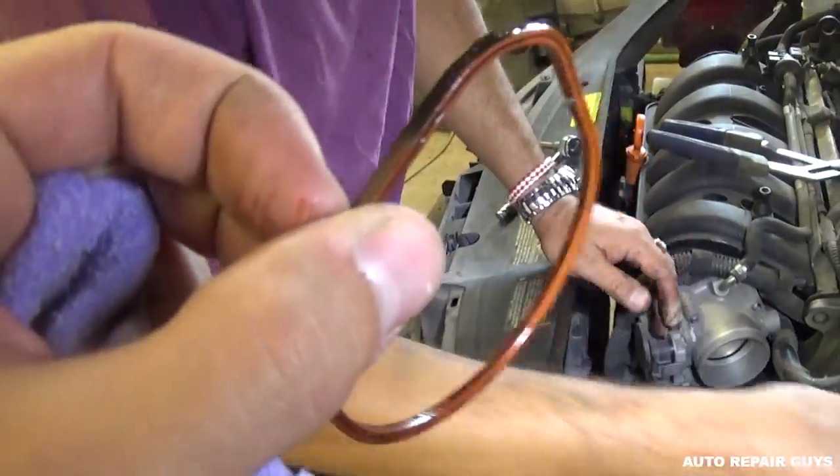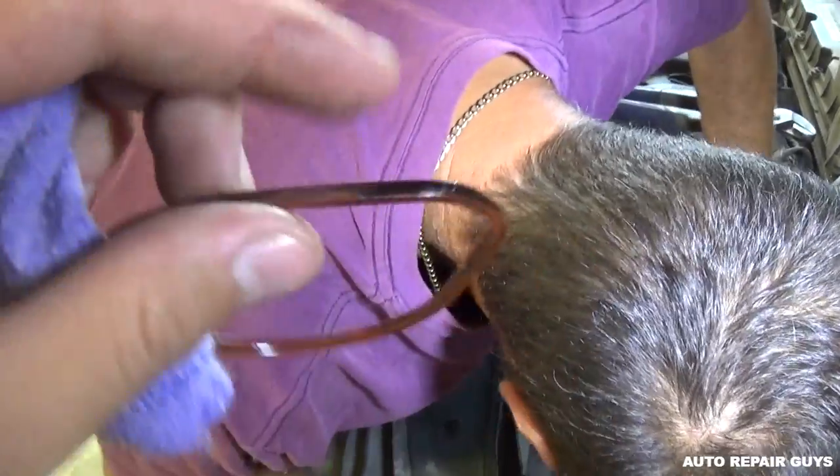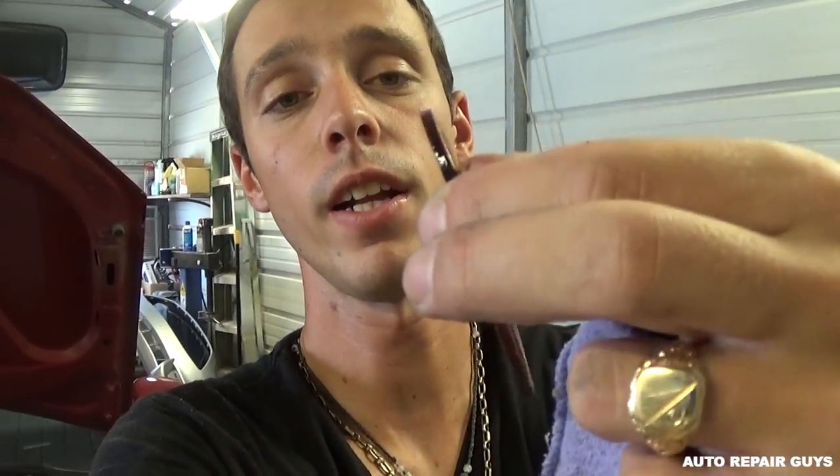With a small screwdriver you can pull it out. That's what it looks like — and that thing is like plastic, not flexible at all. This one should be really flexible and a little bit thicker as well, and this one is definitely not. In our case we don't have one right now — we wanted to diagnose what it is — so we'll just apply a little bit of silicone until we get the new one, so we don't have a leak while we move the car around the shop. That's how you remove it — put everything back together in reverse order. Thank you guys for watching, see you next time.